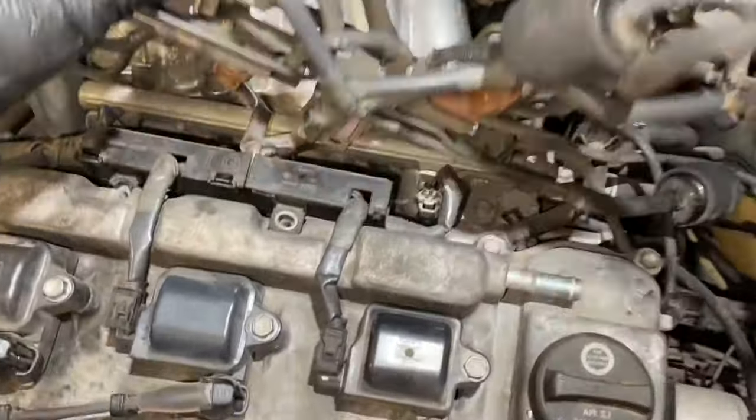For the front one, it's the same process — it's very simple. All you're going to do is take out the bolts, remove the coil packs out of the way, and there's a radiator hose coming through here that you can probably work around. I'll make part two of this video at some point, but if you've done the back, I'm sure you can do the front right now — it's very easy and accessible. So stay tuned for the other video, check the video description, thanks for watching, and please subscribe to the channel if you're new.